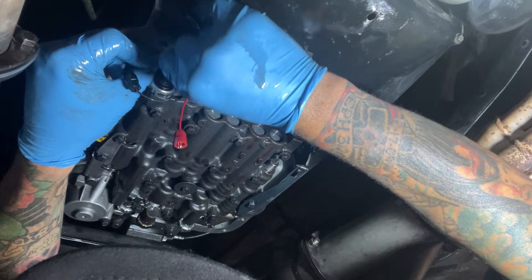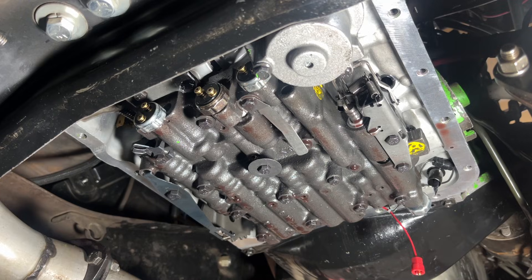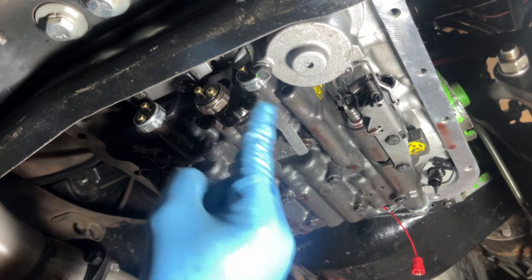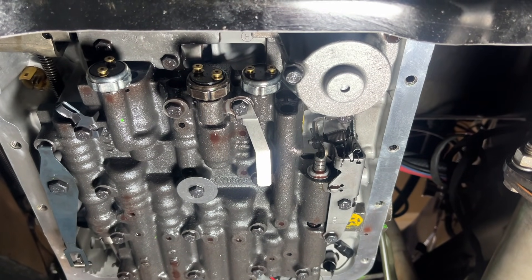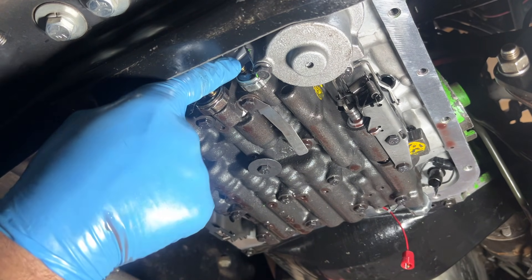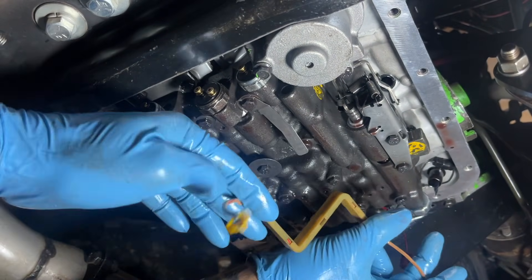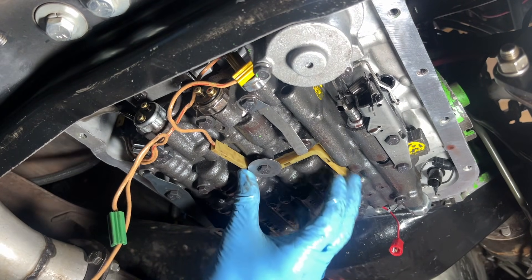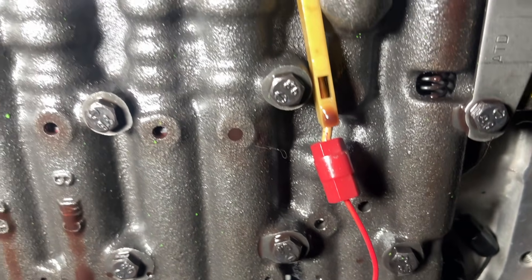We're going to ground this using a bolt. Looking at the back of the transmission on the passenger side, there's the solenoid. The pressure switch right next to it is your fourth gear pressure switch. If it's got two prongs, you can reuse it; but if it's only got one prong, you're going to want to replace it with a two-prong. Since we've got a two-pole switch here, all we've got to do is wire up our solenoid to one pole of our pressure switch, go out the other side to the A terminal, and wire that up and we're good. I'm going to take the old wiring that I stripped down to just the one wire and put it back in place — simple. Just reused the wiring I already had, the pressure switch I already had, and installed the new TCI two-wire lockout solenoid.